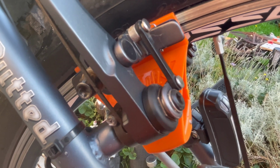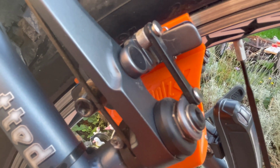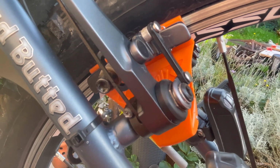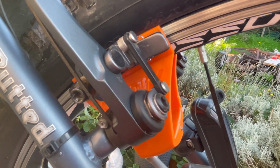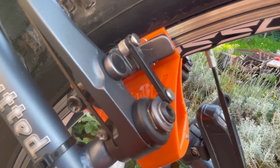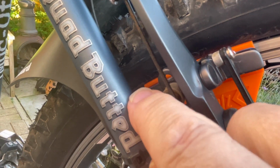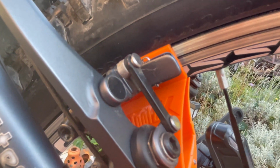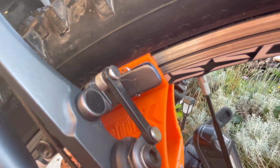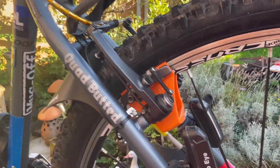And that's your brake blocks set on your bike. If you have V-brakes or cantilever brakes or any other type of brakes, that's the best way of doing it. You used to use a 5p piece. Wedge your 5p piece behind the brake block here. As long as it touched at the front, you were fine. That was the way of getting what they call the toe in correct. Anyway, so that's the brake blocks adjusted.